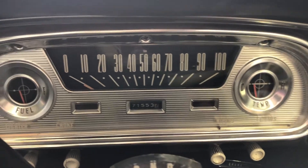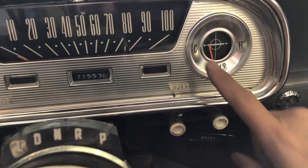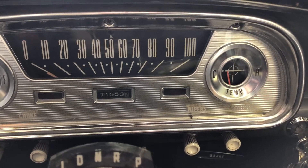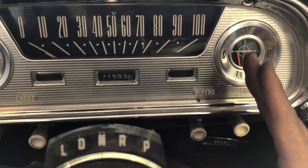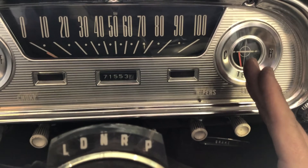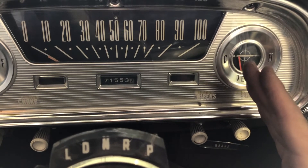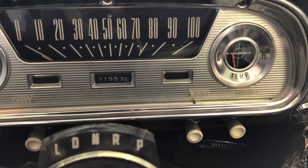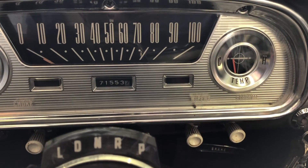She's warmed up a little bit now — we can see we've got the fuel gauge up and the temperature gauge has come up off the bottom peg. Excellent! Our new instrument voltage regulator is working perfectly, and importantly we don't have any of the sporadic ticking I was seeing before, where every three or four seconds the temperature gauge would bang nearly to the full mark and then back down. The engine's been running for a couple of minutes, it's just mildly warm, and it's sitting nicely. I suspect if I take it for a drive it'll come up to about the halfway mark, which is where it should be.